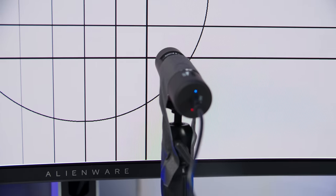Attacking this thing from the display nerd side of things, the first myth I want to debunk: is this a Pentile display? The answer is no, it is not. It is an RGB sub-pixel layout. I've got a little USB microscope here — there's a red, green, and blue for each pixel.